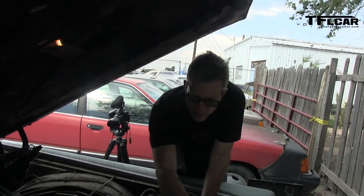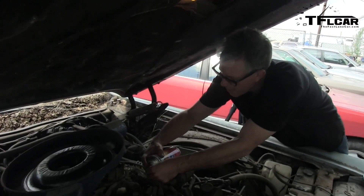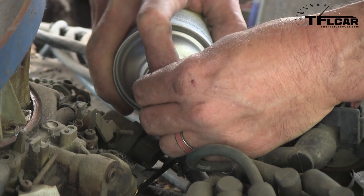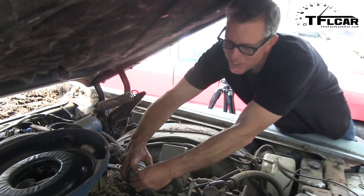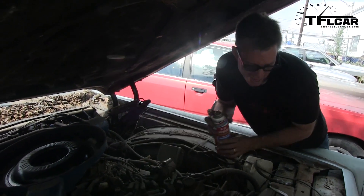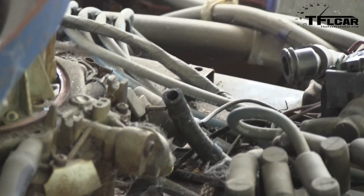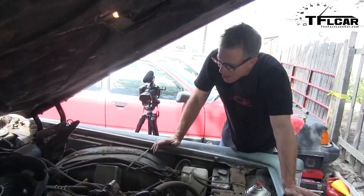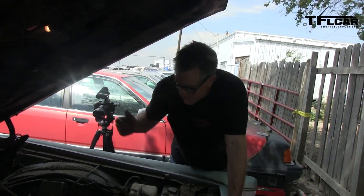On the off chance the clog is here, but usually this is one of those things where you take it to the shop, put it up on a lift, find all the metal fuel pipes, remove them, and either replace them or sometimes you can run carb cleaner down them with a long wire or an old speedometer cable like a roto-rooter and get them de-gooed that way. But sometimes you get lucky.